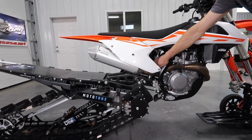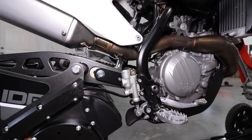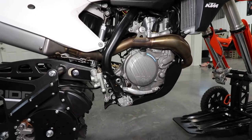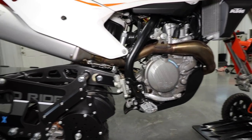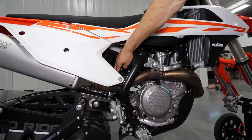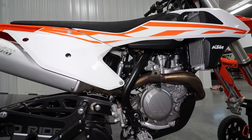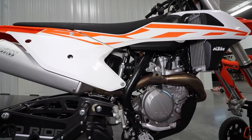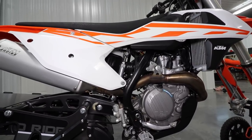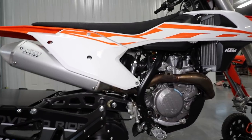Another thing we added this year is we're calling it the IDT — it's a strut that's dampened. Our entire kit actuates with the bike now at this mounting point. What's unique about it is that there's no actual spring effect, no oil, and no maintenance. Inside this strut is actually polypropylene bushings and all they provide is a dampening effect. So when you're going down a trail really fast and hit a jump, land back on the trail, or hit a submarine log you didn't see, that sharp sudden hit will be absorbed — but nothing else. If you're climbing a hill, you won't notice that it exists. You'll only notice it when a large impact hits it.